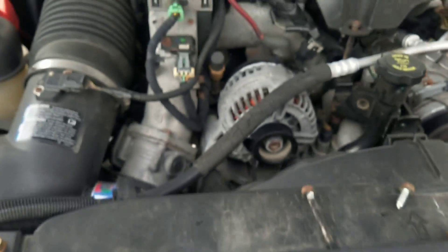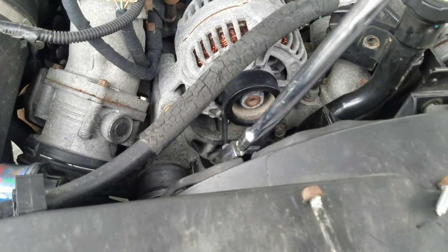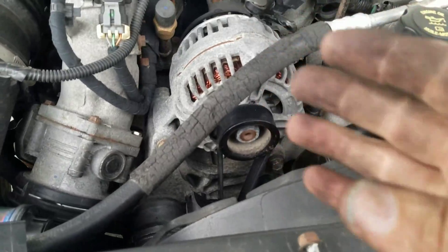You can see I have this little special tool right here. It's sitting on the tensioner like that from that position. And then I took my 3/8 drive, just kind of stuck it in there, go left. It's going to really kind of flex the fan shroud, but you can get past. And that's how you'll be able to take it off.